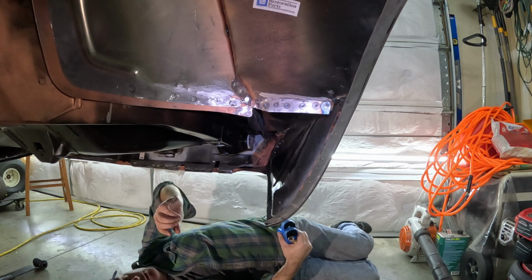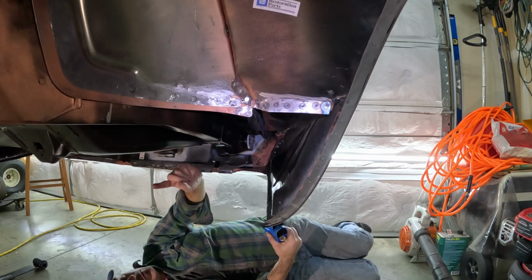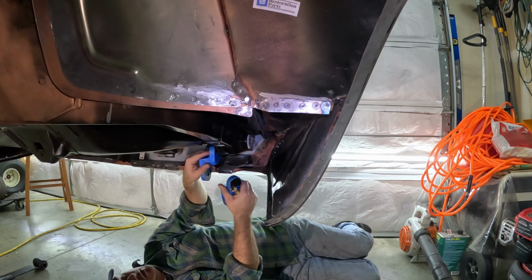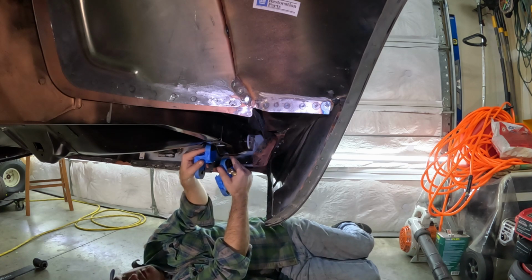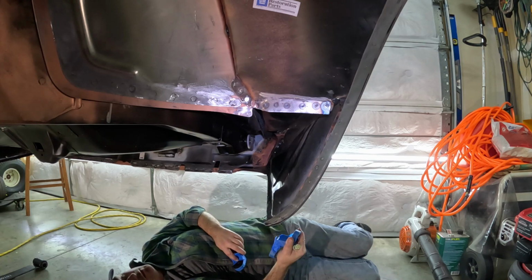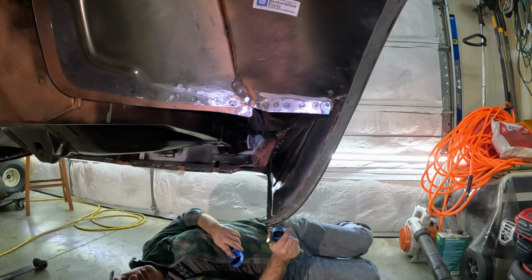So yeah, also too, on this bushing here, there's a grease fitting, or actually a grease port, it's not really a fitting, and they give you a little adapter to go in your grease gun to shove in there. They want that facing forward, because if you have the brackets on there like this, and it's coming straight down, you won't be able to get to it. So that's something that's not entirely clear, but once you figure it out, it makes sense.